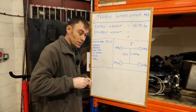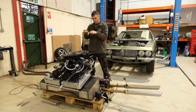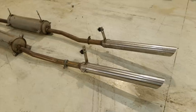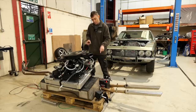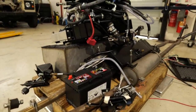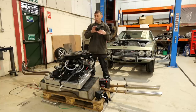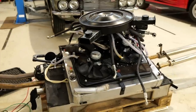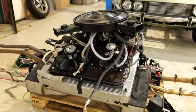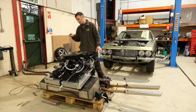Next we've got exhaust, radiators, and all the other bits. We'll try to get them all on one pallet to keep the video a bit shorter. That is a mountain of stuff right there, topped off with an air filter. We've got the exhaust, the fuel tank, loads of pipework, a 12-volt battery — and you're probably wondering why we're weighing that. Well, we don't need a big heavy 12-volt battery because we're not cranking over an engine; the 12-volt on an electric conversion is literally half a kilo and just runs windscreen wipers, lights, and contactors when firing up. We've also got a shifter and fuel pumps.